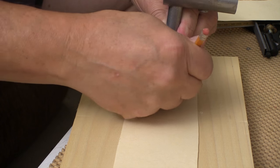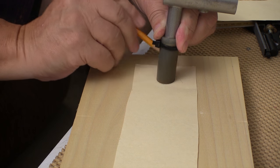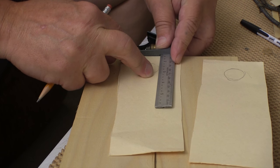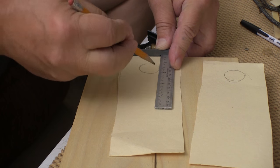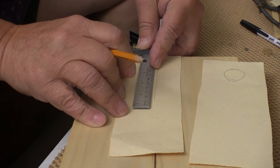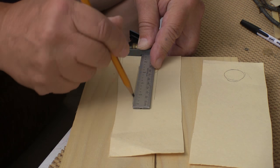I start with just a simple line drawn all the way around the tube. We know that almost all exhaust tube openings have to be turned into slots so we can get the cowl onto the airplane. By doing it this way, I can use a straight edge to make nice clean edges all the way around and get a good-looking slot.